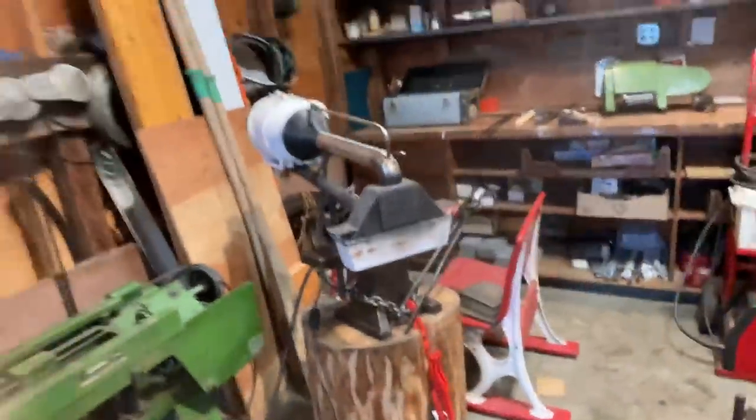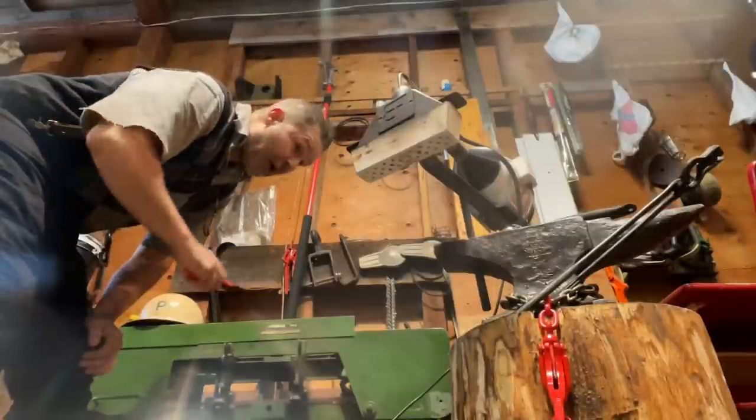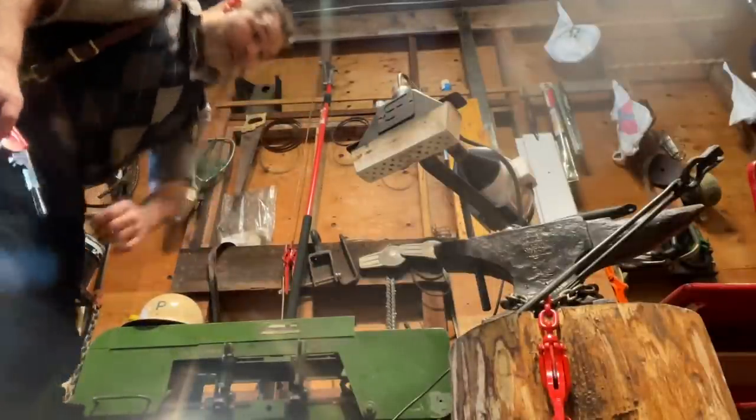Yeah, there we go. My Brad had the regulator set nice when it got here, but when you hit the air to it, it dies. It just dies. So, we're going to do the... You can almost smell it, no propane, good, that's off, okay, good. And you're best to blow the propane out of the system. Turn your fan on, blow the propane out, or you'll have propane up in there and it could woof. You know what I'm saying?